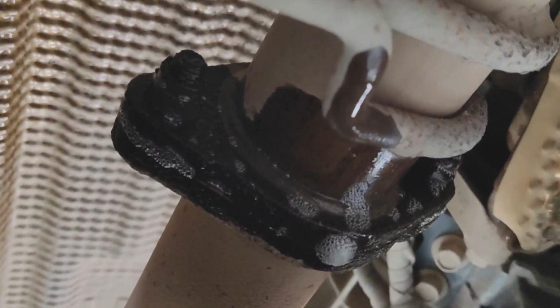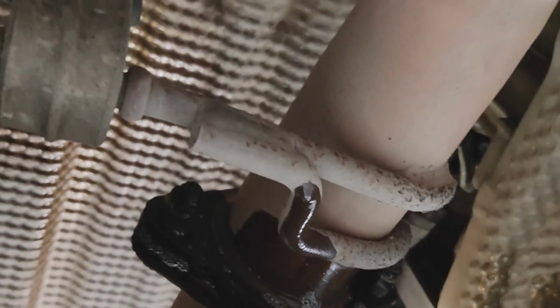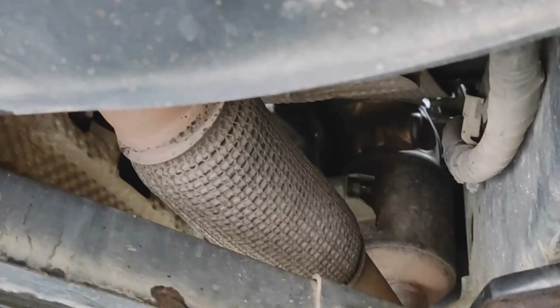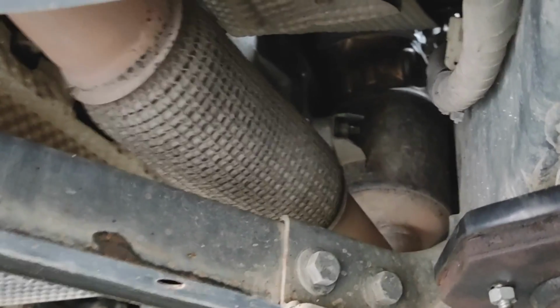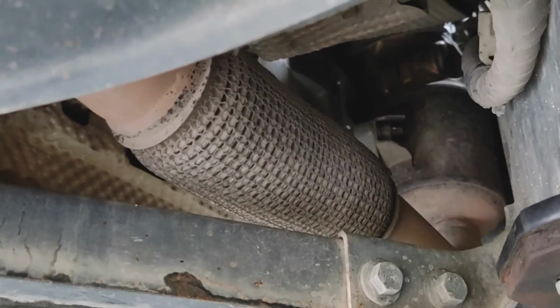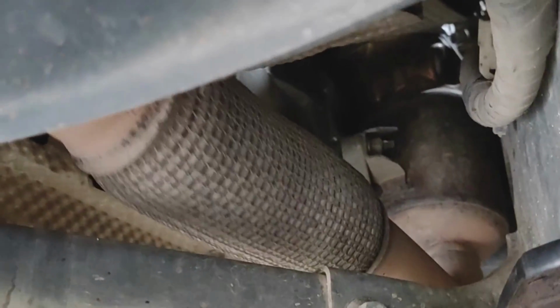The first move is to lubricate the nuts and bolts. And then we're going to rebuild the hangers too out of stainless. So just copy this system basically. Something we noticed here is that the weight of the muffler really moves that flexible around, which is designed to move and that's normal. But I think in taking some weight off of the system, that's going to move that much less, which means that we're going to save some life on that thing there.